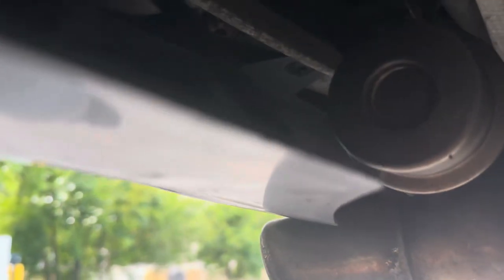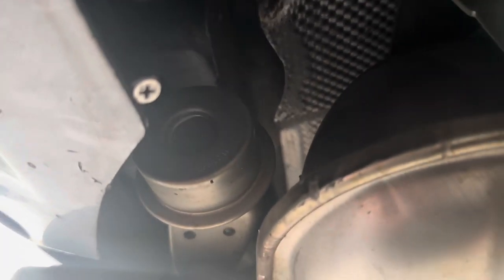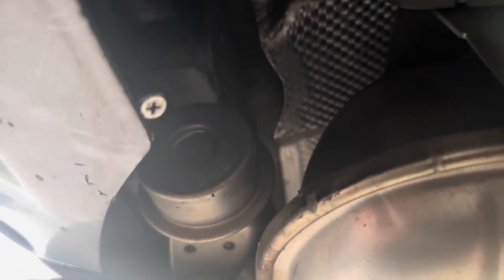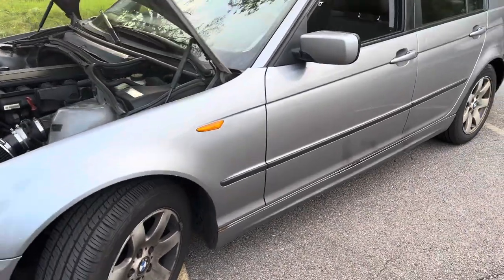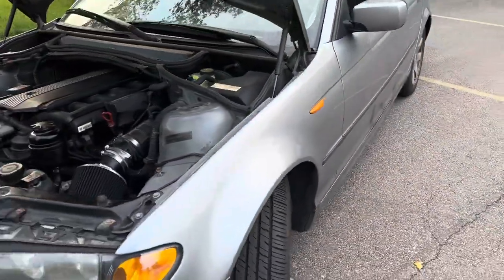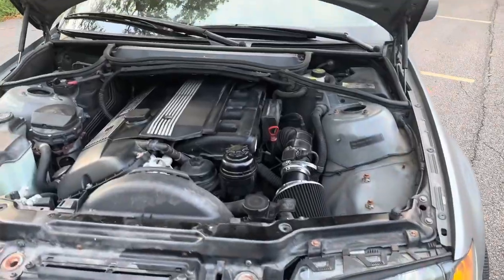You don't even need to jack your car up. This is your valve system right here, and the vacuum line is already off because I took it off earlier. All you want to do is find where your vacuum line is going, take it off or cut it off. I'd recommend taking a screw like I did and putting it into the hose line, so you're not sucking up any rocks, dirt, or dust. Basically, you're just removing that vacuum line, and as long as you plug it, it shouldn't throw any codes.